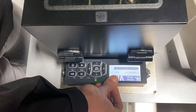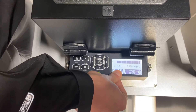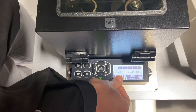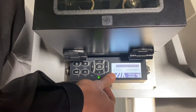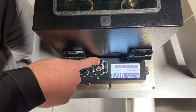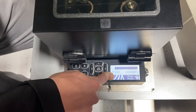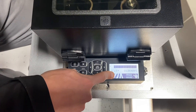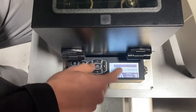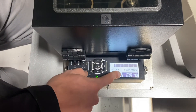Darkness is the amount of heat that I'm applying to the printhead to apply the ribbon or transfer the heat from the printhead onto a direct thermal label to make up my print. Too much darkness is going to give you what's called bleeding — it's going to look like the font is smearing. Too little darkness is going to give you too faded of print. We max out at 30. If you've got a brand new printhead and you're running traditional wax ribbon with a paper label, you'll probably be running this darkness at around 12 to 15.